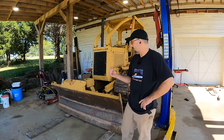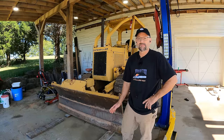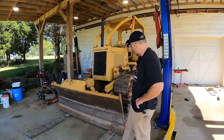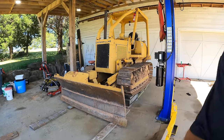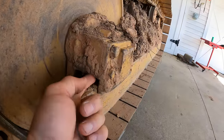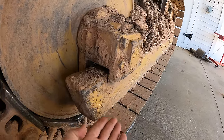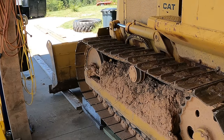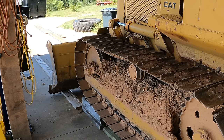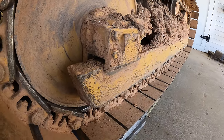She did pretty admirably on that pond job. Her major issue is the fuel tank and that's what I'm going to address today. I also want to address the shimming of the track that the idler wheels slide on — you can see it's got a little bit of play, so those idlers go up and down a lot. That should be easy to do; I'm going to shim from underneath.